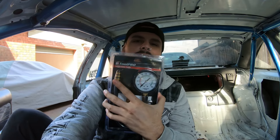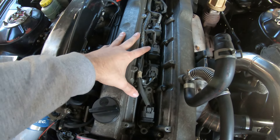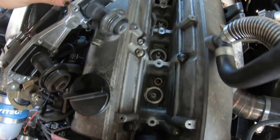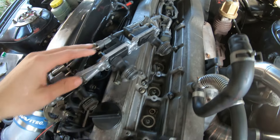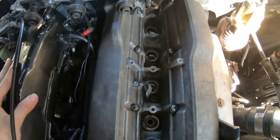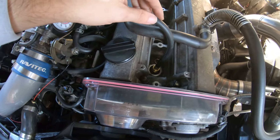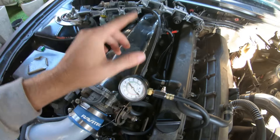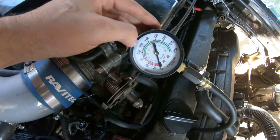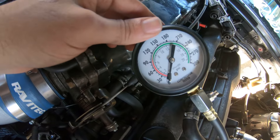So let's see how my motor does when we compression test it. What we're going to do is take off the coil packs - very easy, there are bolts here, you just undo them and the coil packs come out. Then we've got the spark plugs - I'm going to take out all the spark plugs as well. Make sure nothing falls in the holes because it'll damage the cylinder walls - that'll be a costly job. Then you screw in your compression tester into cylinder one. We're aiming for 150. Make sure you've got good battery power in the car, and then disconnect the coil so when we crank it four times it doesn't start the car - no fuel, nothing gets in there. We're just trying to get a pressure reading.